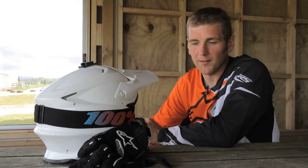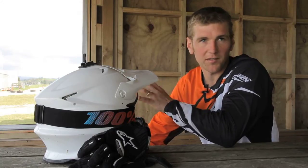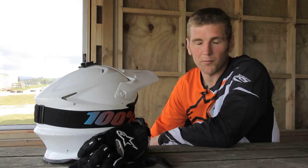I found that because of that, they ended up changing the shock as well. Both the fork and the shock have gone up about 1 millimeter on the diameter, and they add a bit more oil, a little bit more room there for things to play with. And they've been able to get the setup so that now you can have it a little bit higher on the front, no problem at all, which will definitely help the standard bike straight out of the crate. And then you've also got that adjustability you need on the back.